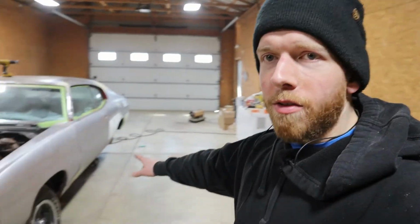So, all right guys, that's going to be everything in this video. I just wanted to show you how I get everything down to bare metal and smooth it out, so it's ready for primer. I think everything's looking really good, honestly. In the next video, hopefully we're going to be laying down some primer. We are very close. We just have to do a little more body work and scuff up the door jambs, underneath the deck lid and under the hood. Once everything's in primer, we'll go through everything and make sure the body is all smooth before we spray it with base and clear.